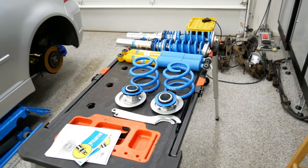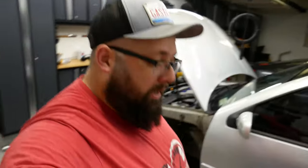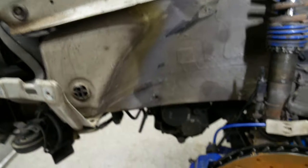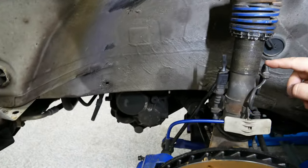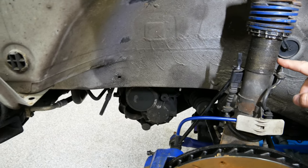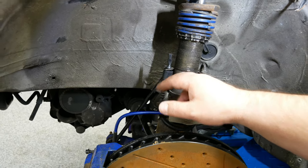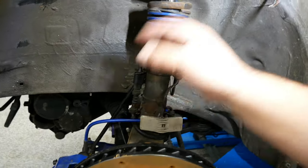Call me stupid, but it would be cool to have matching blue — but I think these are going to be such an upgrade. Since I've already done shocks once in this car, this should be pretty quick. For those of you doing shocks for the first time, it's pretty simple. First, you've got this nut up top to remove the shock. Second, you want to remove the brake line, the ABS wire, and the brake pad wear sensor delete from the actual shock.